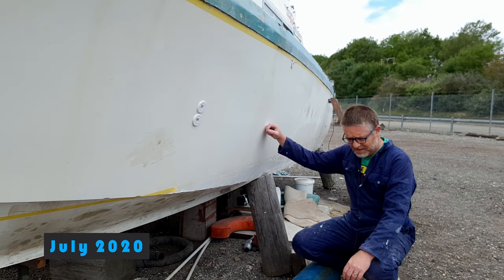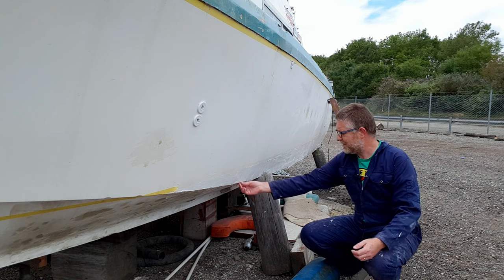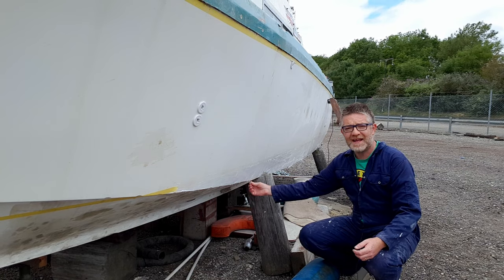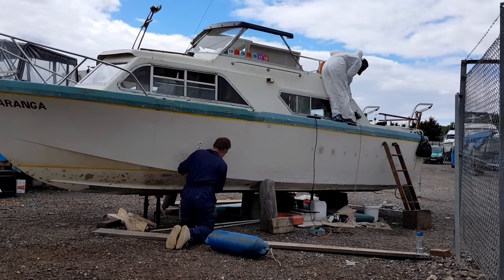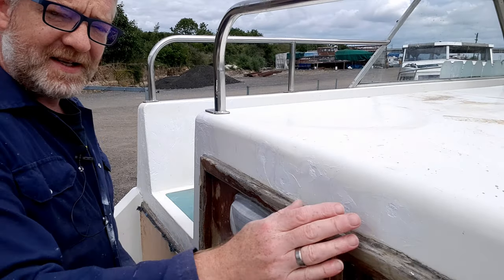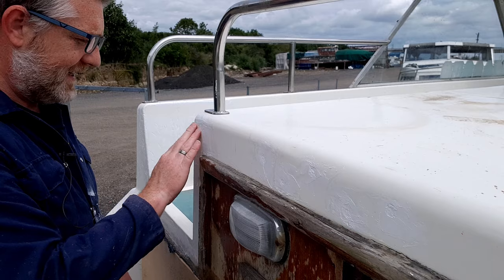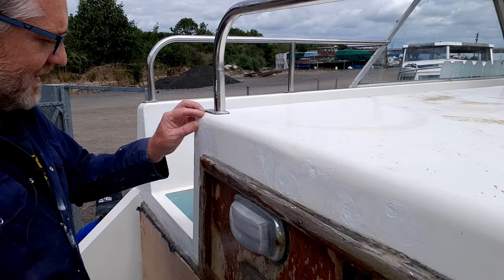It's Wednesday today and the gel coat that we applied over the weekend has really set up. It's still very rough, so the first thing I'm going to do today is to knock this back. Looking pretty good — the only bad bits are low spots. I've done up to about there. There's a lot of dips on this section, so that's going to be refilled and faired. This is an example of the stuff that we did last week — grinding out and refilling — and now it's set up. It needs to be sanded back and the low spots filled.